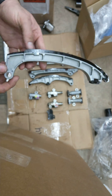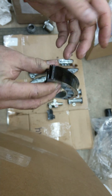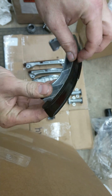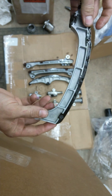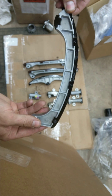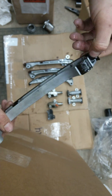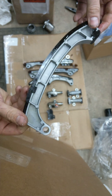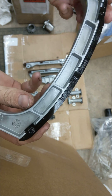The slippers and the dampers — there's a measurement they use. I don't know where it is, but somewhere, if it's less than one millimeter of material, you want to replace them. These do slide back and forth a little bit, that's fine. Obviously, if there's wear on the tensioner area where that hits right there, or if some of these tabs are broken off — I think one of mine were — I'm just going to replace them all.